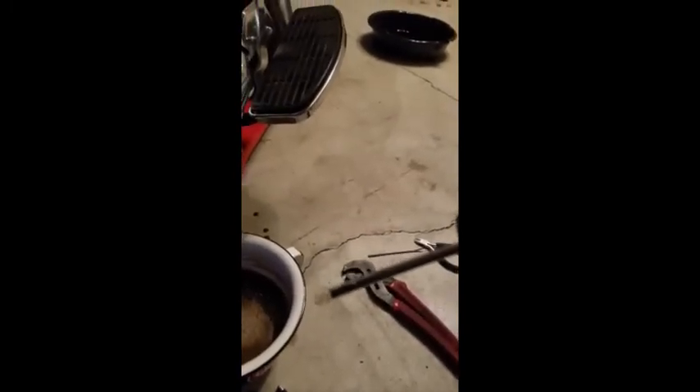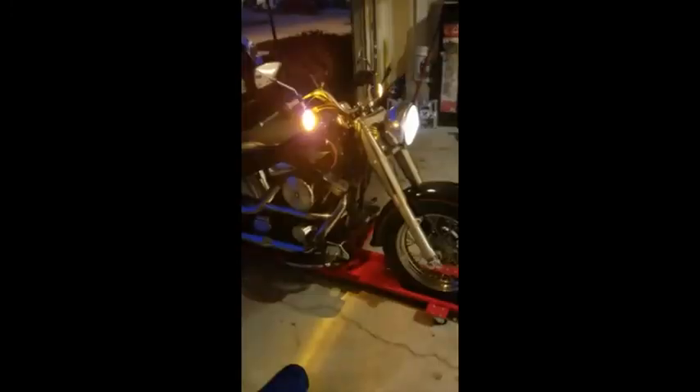The final step now that I've done the oil purge is to come back to the oil container and top it off with another coat of oil. I put two quarts in and drained out quite a bit, so I'll probably need to add another quart. At this point, add the remaining oil, start the Harley, let it run, turn it off, let the oil settle, and then check your dipstick to make sure you're at the right level — full or add. This concludes my video. There she is, fully running, sounding good with all new fluids in her.